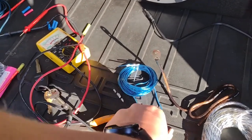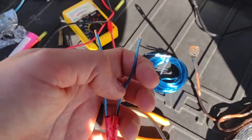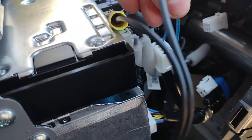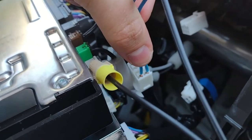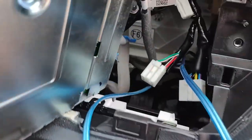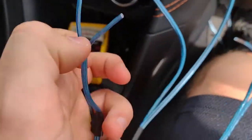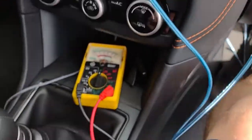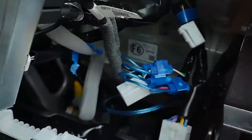To see which wire ran to which speaker, I took an old 3.5mm audio cable and jerry-rigged it so I could send signal from my phone. It made the job so easy to find out which speakers were which — I simply put on my favorite tune and listened to hear where the sound came from. To run it all, I used heat shrink to keep all the speaker cable together, and I clearly marked which was being run from the driver side and passenger side to avoid confusion. Now that I know which speakers are which, I can tap into the wiring for some quick splices. These are quick — this only took like 30 seconds. That's not true at all. And done — so quick and easy, just like the box said.